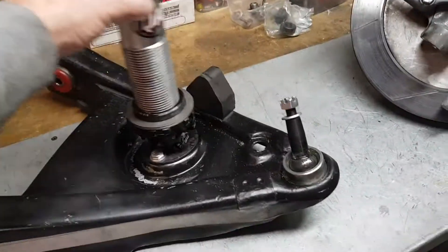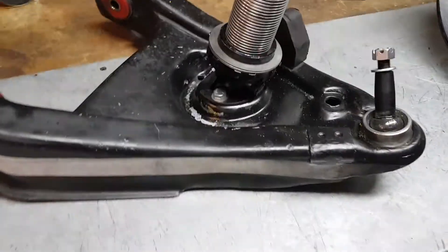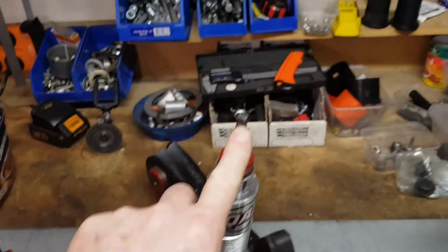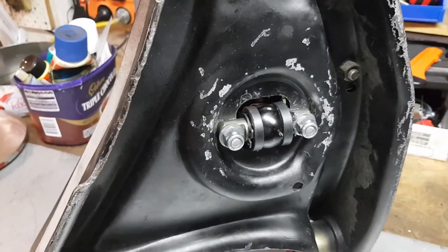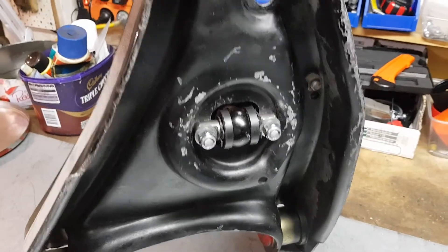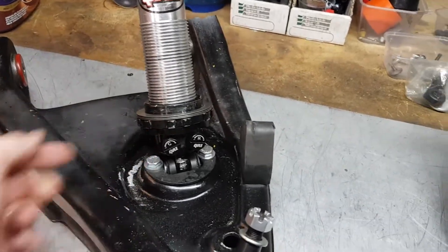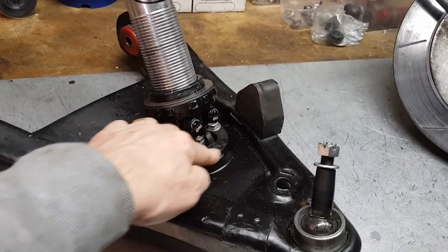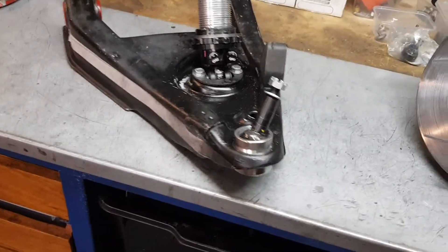The other upgrade I've made — I'm not sure it's the way everyone would want to go, I'm not sure I'd do this one again — these are a semi coil-over that you get from QA1. It gives you adjustability in height, which once you start setting up your car you'll find very handy. The problem I have is I must keep the centreline of the shock, so I cannot move this mount and I'm not supposed to move this mount. The centrelines have to stay the same. It's advisable with the spring weights we'll be running to put that rod on top here. That's going to give you extra ride height equal to the thickness of the pin, which you'll then want to adjust out. The whole weight will be sitting on top of the arm and you'll be in a good place. At the moment I've just made an extra plate up here so I don't pull the bolts through — worst case scenario there's no deformation, so I think I'm okay.